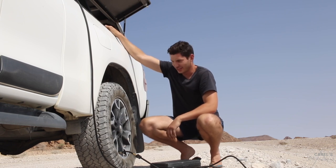It at least looks like it's working - I don't feel any air coming out. So I just quickly redid the plug on the tyre when I got to Solitaire. The first one, as you guys saw, didn't sort of go in properly so it started to leak a bit of air again. I just pulled that one out with some pliers and then popped in a new one. Still seems to be okay - I'm not hearing any air but I'll just double check now. I'm still heading back home now. I hope that you guys at least enjoyed the video - it was definitely an awesome little long weekend. I definitely recommend for anyone coming to Namibia to go to Solitaire and NamibRand. It really is an incredible place. Thanks again for tuning in and I'll see you guys in the next one. Cheers!